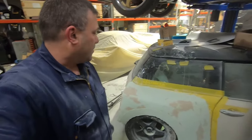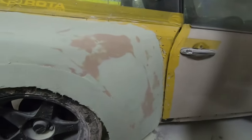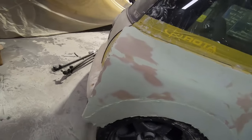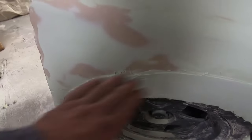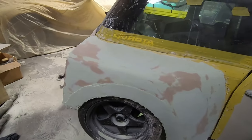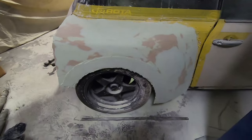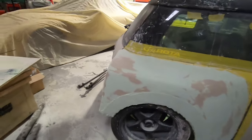That about concludes what I'm going to do tonight. I've made a bloody mess everywhere, but I have got some starting definition of the guard line. I'm not really sure what I'm doing at this point, but I've got an idea — I'm going to slowly build this up on the edge and get it looking how I want it, then blend another bit of body filler in there, and there'll be a ridge line exactly where I need it. I might even extend this out here a little bit just to give it a more pronounced ridge.